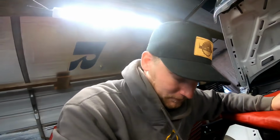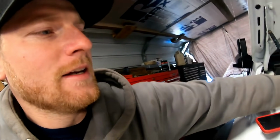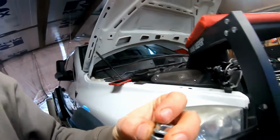And when I say it broke, I mean I was tightening and tightening and tightening. Nothing seemed to happen. And these chintzy little nuts they give you are only supposed to go to 27 foot-pounds, which isn't that big a deal. But I think my torque wrench was having a field day with me. So I stripped out one of these, and then I was like, you know what? We got some upgrades. This is actually a bar nut that holds the chainsaw bar on. Same thread, everything, except it's just taller. I had stripped one of the stock ones when I installed it, and replaced it with one of these big guys. No problems. So I was torquing, started feeling a little tight, and then I heard it pop.